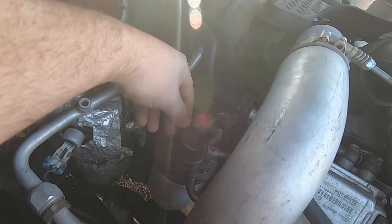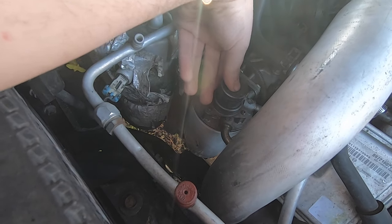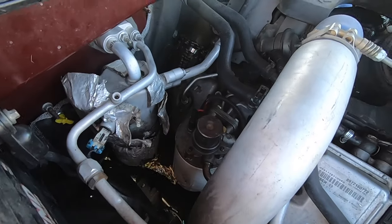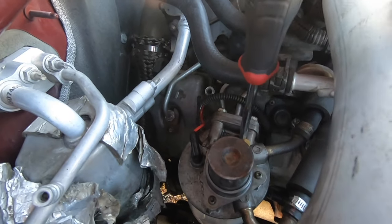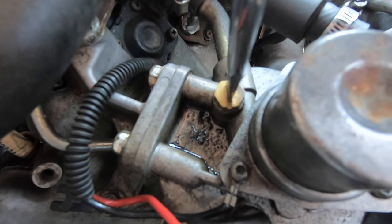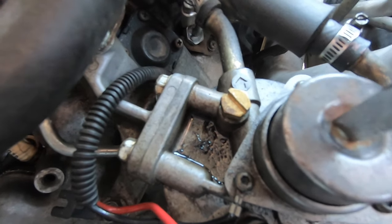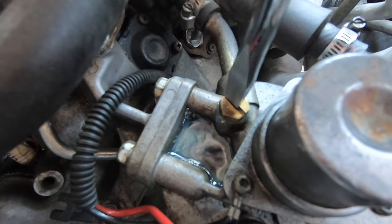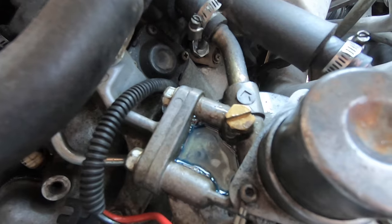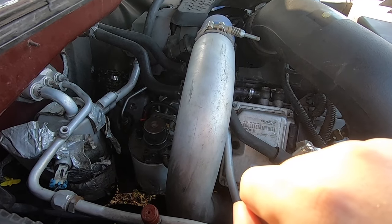Out under the hood here behind the charge pipe you've got your filter head and a primer on top of it. You push this — it's very soft, it should not be. When this is primed up that thing should be pretty well rock hard. Behind it you've got a fuel bleeder screw. We're going to loosen this screw. You can hear the air come out — I'll pump the primer a couple times. Now we have some fuel. We were totally air-logged there. That's good to know. The question is: how does it get air-logged, why did this happen, and how do we fix it?